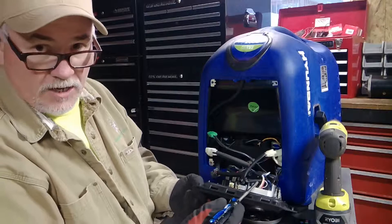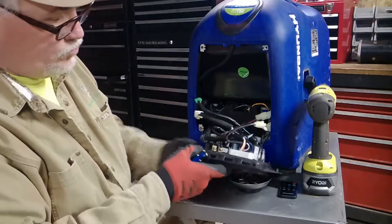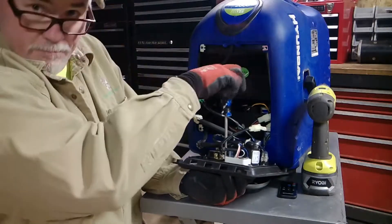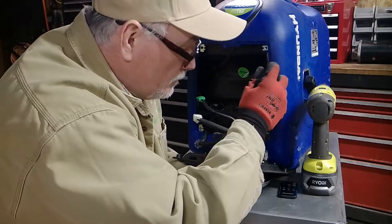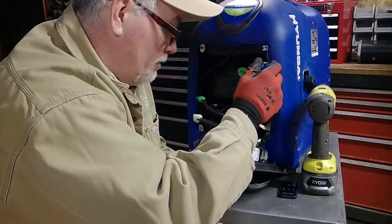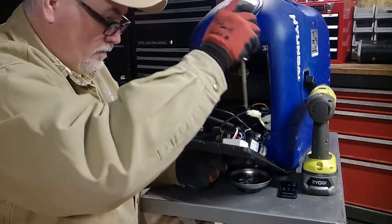This is the CDI that we're going to change. This white unit right here — we're going to take that out. It's held in by two screws. The face plate is right here, so put your hand on that because you're going to have to capture it. You don't want it to fall on the ground. This is why you use a magnet tip screwdriver — because you can take out the good quality screws easy enough and not have to fish for them.